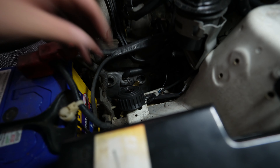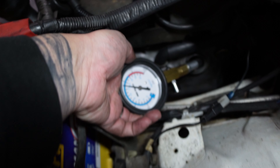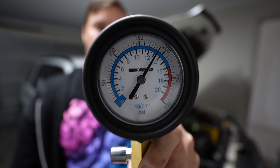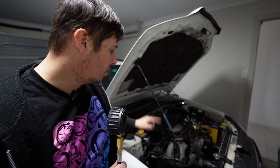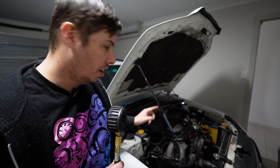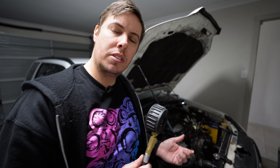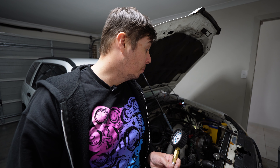Let's see the results for Cylinder 4 — it's sitting at about 180 psi. For Cylinder 2 we've got about 180 psi as well, just like Cylinder 4. So the cylinders are roughly the same. I still have to try Cylinder 3. I'm not sure why the tester kept popping out, but the threads aren't gone, so I'll have another try and see whether I can actually get it to work on Cylinder 3. All the other cylinders are pretty good — compression is quite high, which is a good sign.